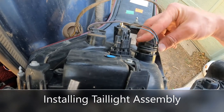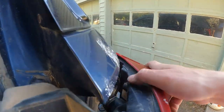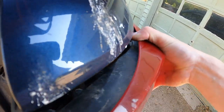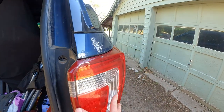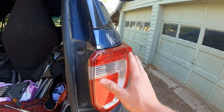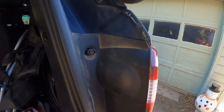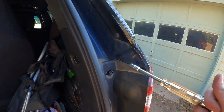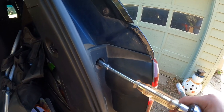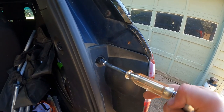Now that we've got our new bulb in there, just go ahead and push it in and line up your pins. Turn that clockwise. Make sure you get that little white pin and all those pins lined up — this part helps if you have two hands, but we got her with one hand. Now we're going to put the screws back in. Remember, these screws are a 5/16ths, so go ahead and get a ratchet and start getting those tightened down. Then we will put our little cover back on.